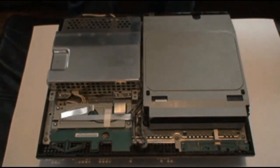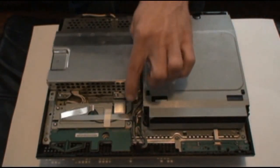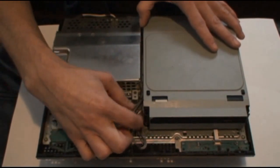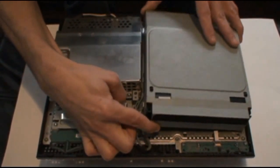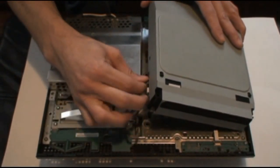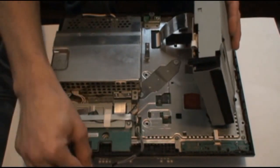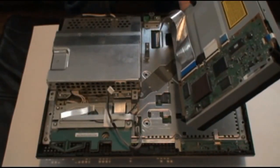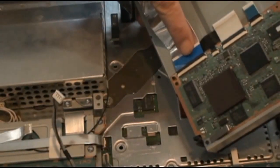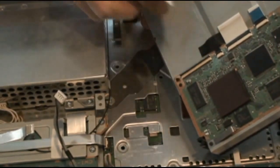Let's look at removing the drive first. If you look at the front of the drive in the corner, remove the power cable — just lift up slightly. It might give a little pop but that's okay. Lift up slightly and just pull that right out. Put that to the side, tilt the drive up, and on the bottom on this little connector here, just pop up on the jaw and pull that out.